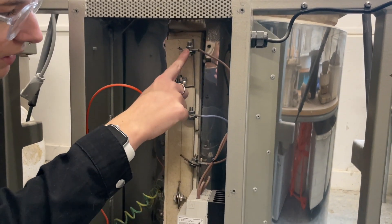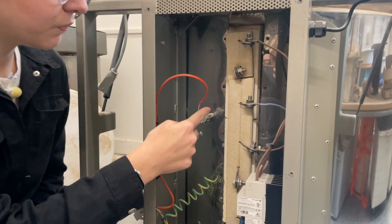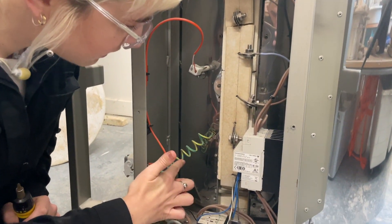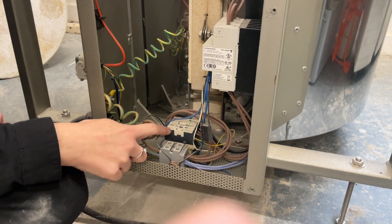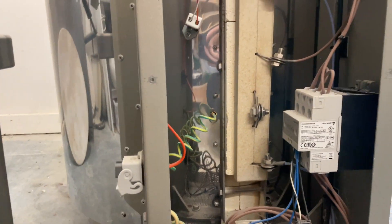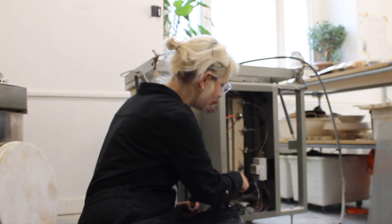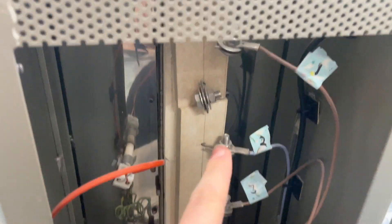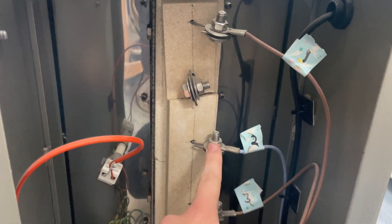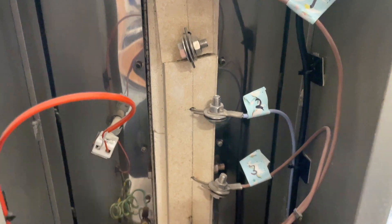While we're here we can have a look — these are the element banks, so we've got one, two, that's it, which is pretty cool. This is plugging into the thermocouple which is like the temperature gauge. This is the relay — this is the thing that makes that clicking noise when you have a kiln going on and off. If you don't know what something is, don't touch it. We're not electricians — just this stuff: one, two, three, four — brown top connection, blue top, brown bottom connection, and blue bottom. That's all we're touching.